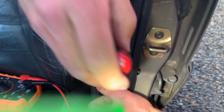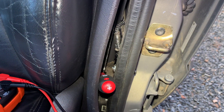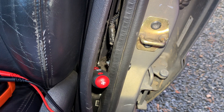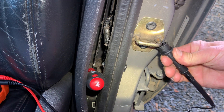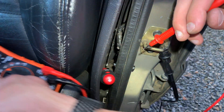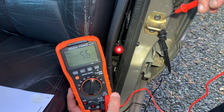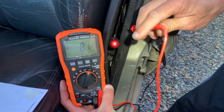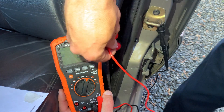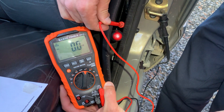I'm going to put my screwdriver in here to keep this open so you can see it. Now here's the part that gets a bit opposite to what I told you — I know I said the battery ground is the only known good ground on a car, but I don't have a jumper long enough at home. I already tested this. I'm going to show you on this voltmeter. Now look what happens if I try to touch that lead coming in right from the computer.